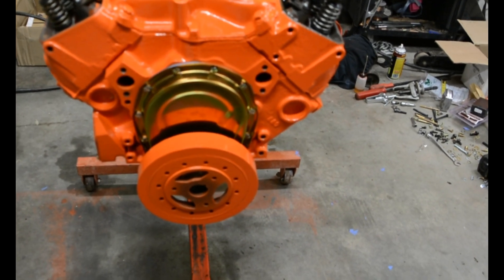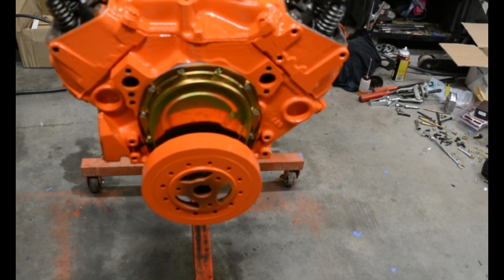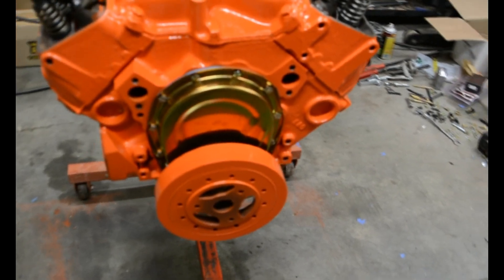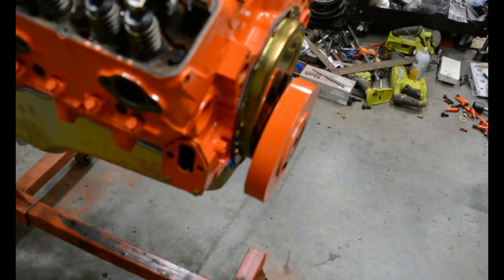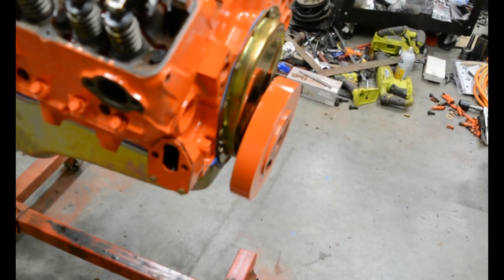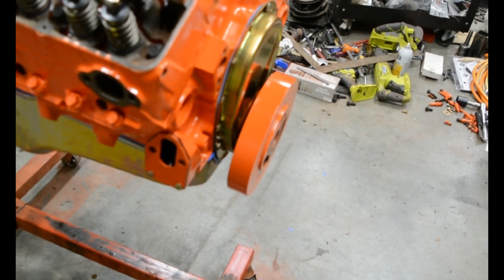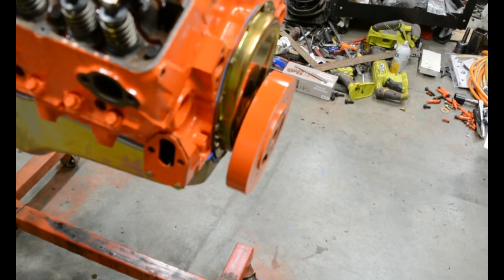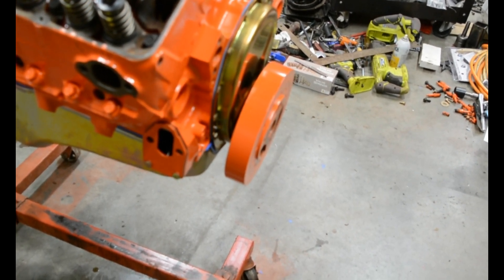As you can see I stopped to put the bolt in the damper. I've got to wait until I pull the 305 out of the truck to steal the pulley and bolt all that up. Here's the pad for the mechanical fuel pump. I actually have a JEGS brand pushrod in there that's got a bronze tip on it for the roller cam. I'll just take the fuel pump off the 305 because it was replaced not that long ago.